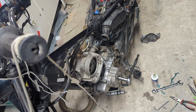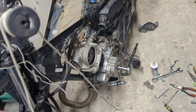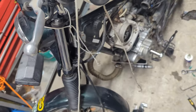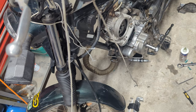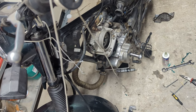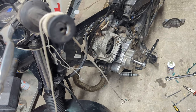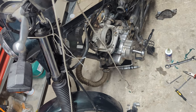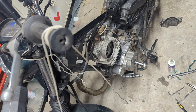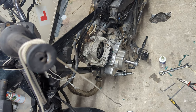Well, it looks like we've hit a snag. The automatic tensioner doesn't appear to be as long as the manual one and so it's not making contact with the cam chain guide. I think the holes on the side of the head are a different size for the two different tensioners. That looks fully extended. Sorry, folks — it's getting late. I've just picked up the old one and offered it up; the old one is considerably longer. So I'm either missing a few bits or the tensioning arms inside are slightly different — probably with more of a nub on the back to press against the auto tensioner. I'm going to have to go back to the workshop manuals, find out the part number differences. They're going to be another one of those parts that seem to be rocking horse poo. So dreams of a journey up the road are done for now. I'll post another video when I've got the right parts to sort this out. Hopefully it's not too long — have a good evening, ciao.